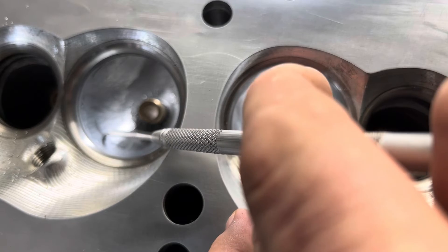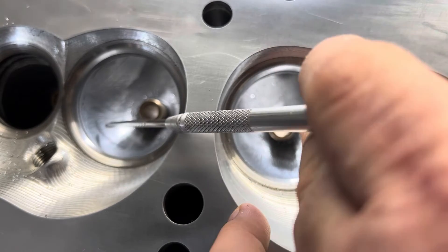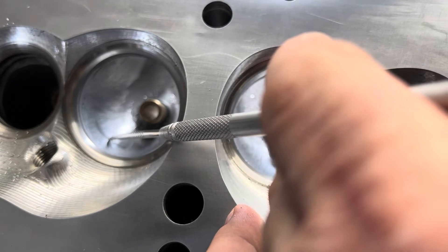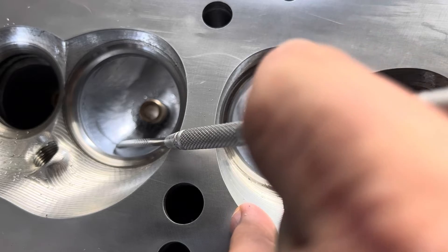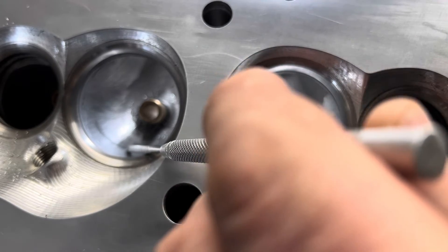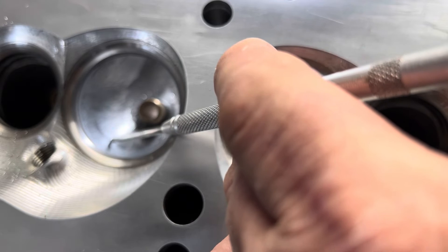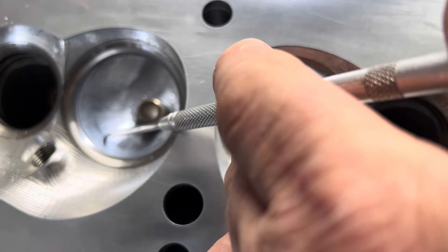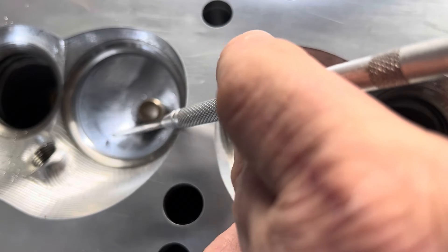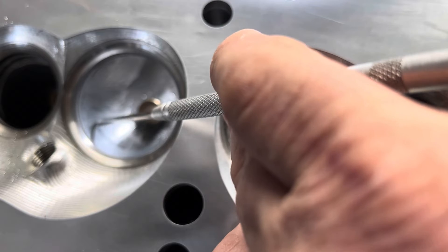There are a lot of inconsistencies — look at this deep area. This is not a make-or-break situation, guys. When you're porting and you see something that's this superficial and cosmetic, that's not a make-or-break situation for your port flow. It's just a cosmetic issue you have to work out.